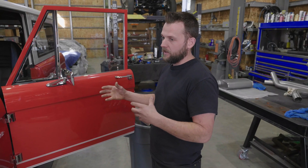One unique thing we did on this one — we put our own roll bar in. It has three-point shoulder harnesses like a modern car, very comfortable. It gets away from the door dings we were finding on the other Bronco from the seat belt retracting into its location. By going to the shoulder harness we've reduced a lot of that and increased the comfort getting in and out. It's actually a three-piece roll bar with Cro-Moly knuckles between each joint — the joint itself is stronger than the physical cage, so we feel confident it's not only aesthetically pleasing, it's also safe.